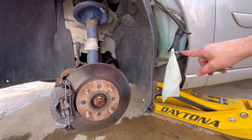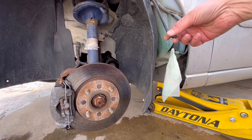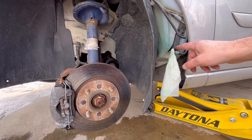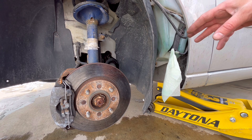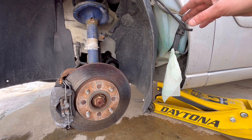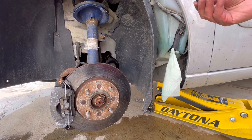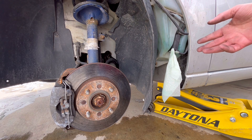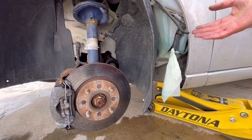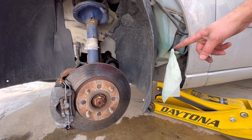I did find out this one goes to the front windshield — the only front windshield. This goes to the rear window right here, so the tube up top comes off the black portion of the pump. This tube is clogged. Now this vehicle came from a much warmer climate. There are a couple of possibilities: this could have a kink somewhere in it, or it could just be that it's got frozen water in it because it's been stagnant.